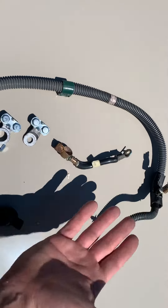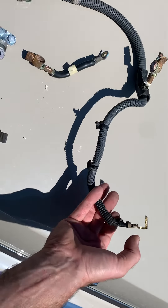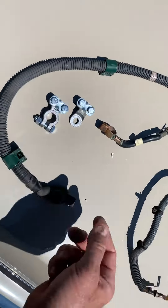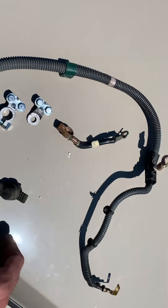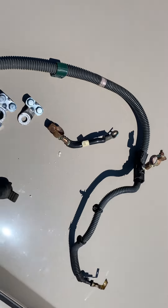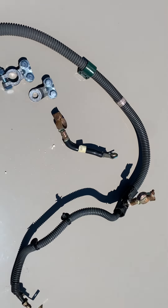If it's got a lot of corrosion in it, you replace the whole cable. If it's just the end, and you've got plenty of room to work with and you can cut it off with a good clean end, by all means — you can get away with that. You don't have to take all the cables off the car, but in some cases you've got to do it this way. That's why you'd want to go with a whole cable instead of just the ends. Take care and we'll see you guys under the hood.